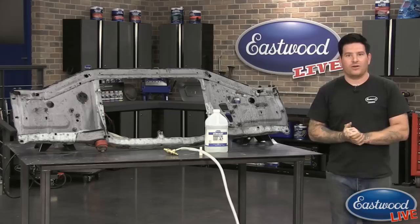Scott: Something to note — did you cover the gallon-per-minute spec? One of the things to keep in mind — the connection is kind of a standard on most gasoline-powered pressure washers. With electric ones, a lot of them are a little bit lower. One of the specs you want to make sure of is that you have a pressure washer that can do at least 3.5 gallons per minute. That's going to create the correct flow rate to pick the media up and run properly.